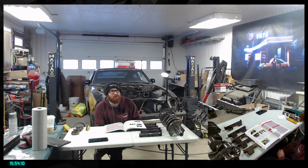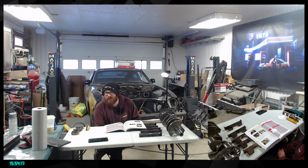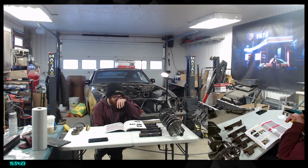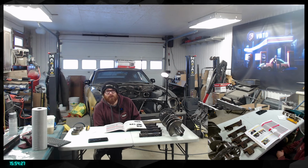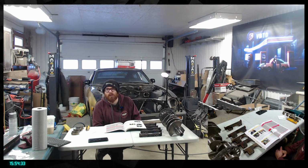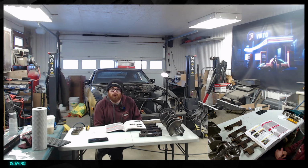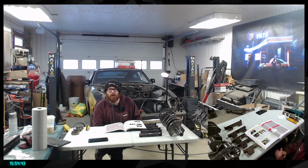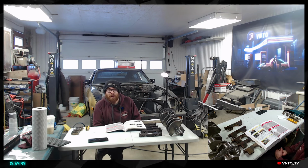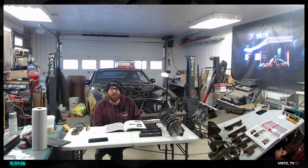I will probably look a little more at an E85 tune instead of anything else. But the fuel pumps are not designed for that, most of the fuel system is not, so there will be a conversion to do. That's also a way to improve reliability. E85 uses more fuel, but also burns cooler than regular fuel, so it helps reliability, even though it creates a lot of water in the engine, which means you need to change the oil a little more often. But here in Quebec we don't have E85 anywhere near me. I think it's a 4 or 5 hour drive just to get some.